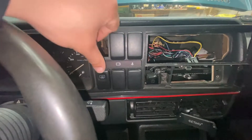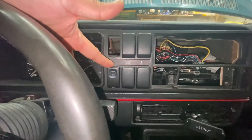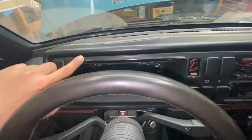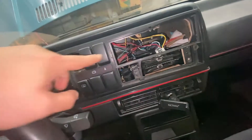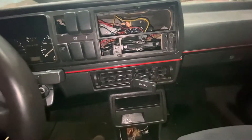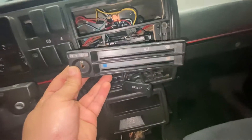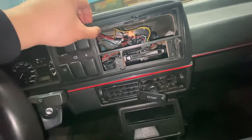The rear defrost is in but I took off the bezel. If you've never taken it off before, it's pretty simple — there are three screws: one here, another here, and one here behind the radio. Take the radio off, and behind the climate control there are two screws and one 8mm bolt. Then the climate control should just pull off after taking off the levers, and the bezel should come off.